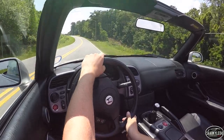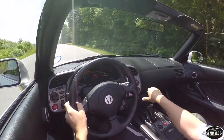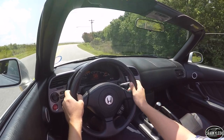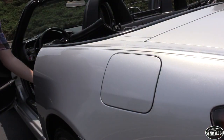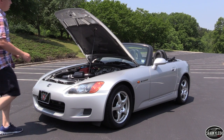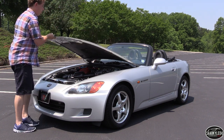If that's not enough, Honda developed a unique metal honeycomb catalyst that reduces back pressure by 40% over conventional ceramic units. While the S2000 doesn't have a ton of low-end grunt, it coaxes you to drive at the limit if you want everything the car has to offer. It never gets old. The S2000 carries a 13.2-gallon fuel tank and requires the use of premium unleaded. EPA fuel economy estimates range between 20 miles to a gallon in the city and 26 miles to a gallon on the highway.